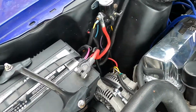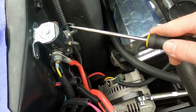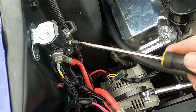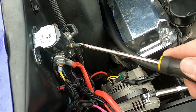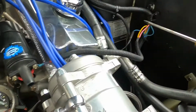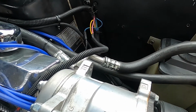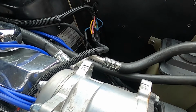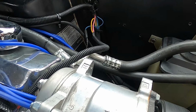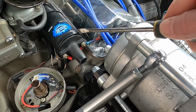First of all, if we come over here, we can see on this particular Ford, this is your ignition for during start activity, and this is the starter power. When you energize the starter, the ignition comes over here. It's a yellow wire. You can find it over here on the harness on the firewall. And that yellow wire comes over and runs ignition. That bypasses all the rest of the harness while it's starting and provides the coil 12-volt power.